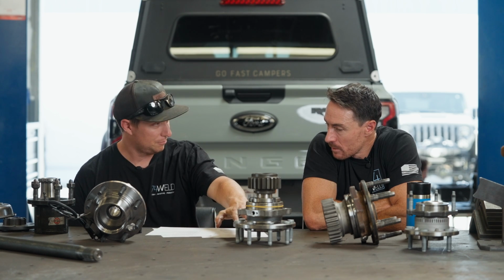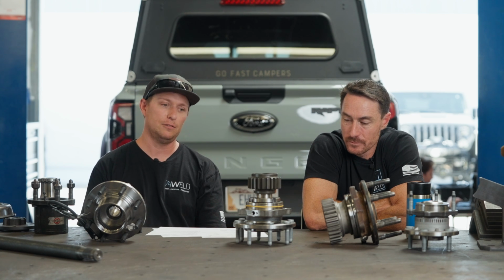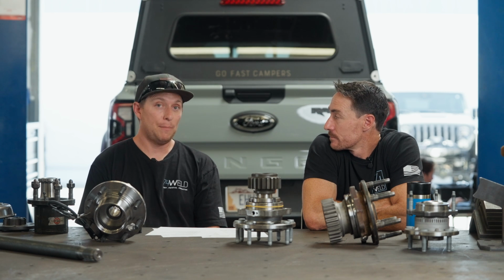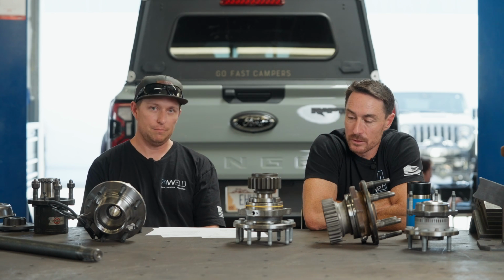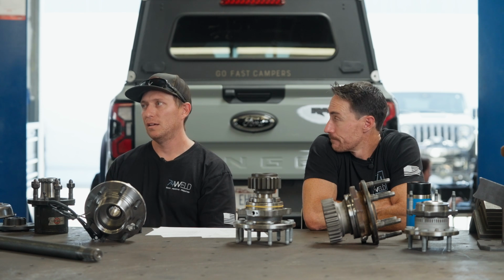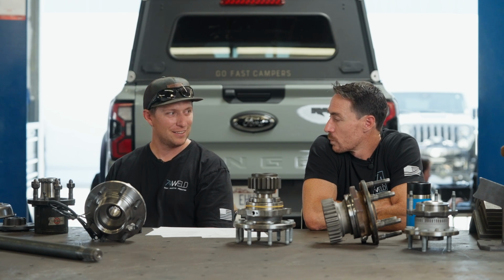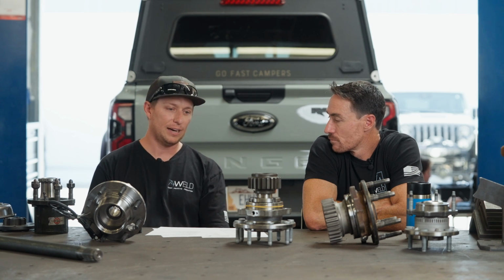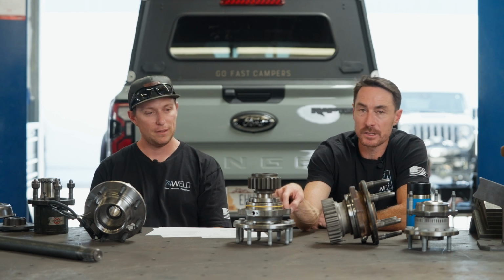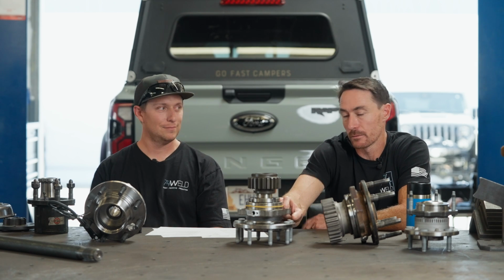I guess it's worth touching on. This is our unit bearing right here. So people ask us, what is it? Is that a 99 to 04 all the time? Sure. It's essentially the same bearing pack, same strength as one of those. We have it manufactured with a tone ring in it. I'm willing to talk about a lot of this stuff because I filed a bunch of patents around it, so I don't really care.